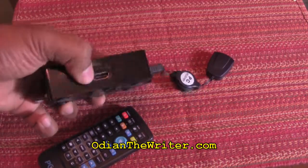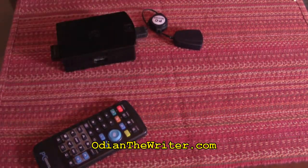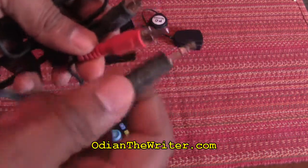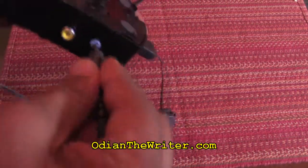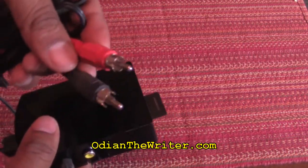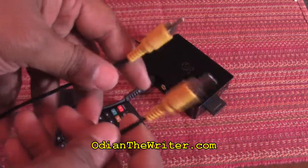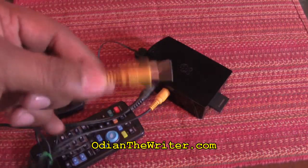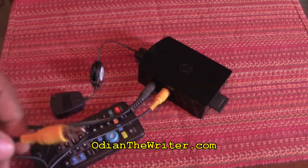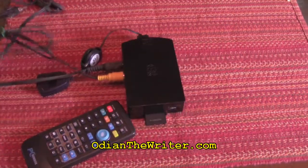So all together this is $30 for the keyboard, eight bucks for the remote — and you should have an eight-gig SD card in your house somewhere, if not $10. Next up, if you have a car with composite connections, you're going to need one of these — a 3.5mm to RCA cable. You plug it into the audio port, then plug the RCA connectors into the audio area of the car so you get audio to your speakers. Then get one of these little composite video cables, plug it into the video output, and then into the video part of your auxiliary port on the DVD player already in your car.